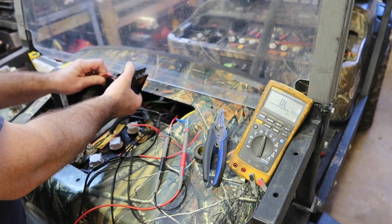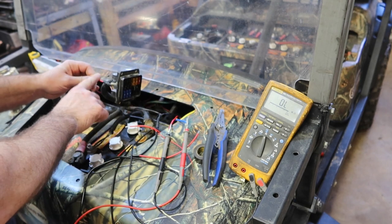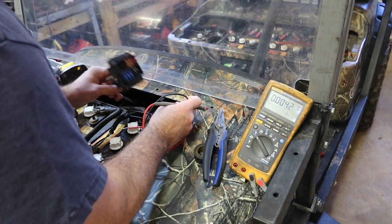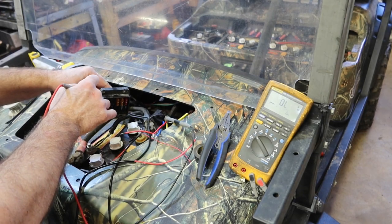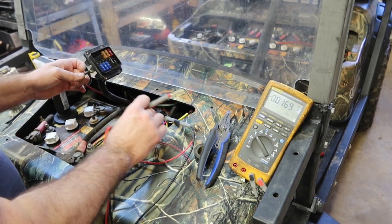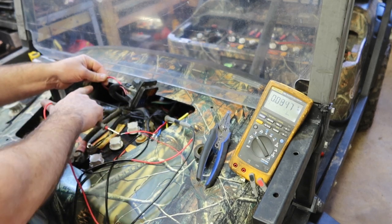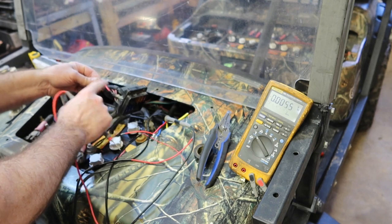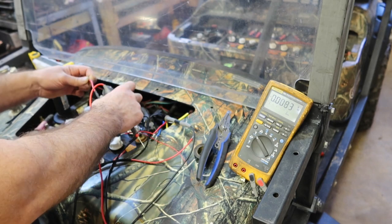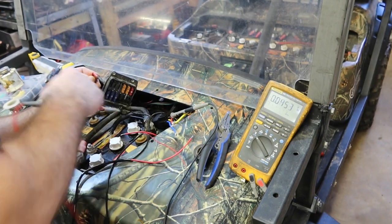and that's gonna be my switch. It's gonna control the hot side of this fuse panel. So let's cut this fuse panel, which right now, by the way, is hot. So let's see, if I go to ground off the relay, and then right here, I've got 12.6. So this right here is hot all the time. So when I go to disconnect it, this side of the wire, the one coming from the batteries over there, is my hot side. This is what's being fed. So I'm gonna break it here, and just keep in mind, don't let this touch anything because it will spark. And we're gonna use the relay to break that connection.